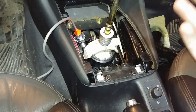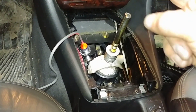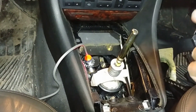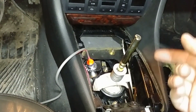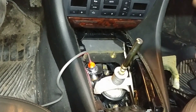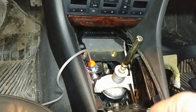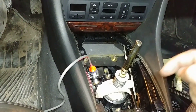You've got to pull the e-brake up, take the key out with the driver's door closed, and that signals to the little control module that the car is in neutral. You get out of the car, lock the car, and only then does the engine shut off. That's how the module knows the car is in neutral — you've put the e-brake up, taken the key out of the ignition, opened the driver's door, got out, and closed it. It needs that door-open-and-close signal with the engine still running, which means the car must be in neutral.